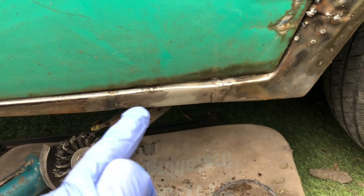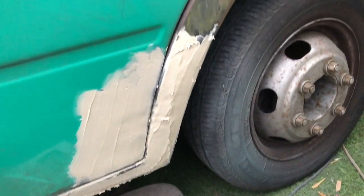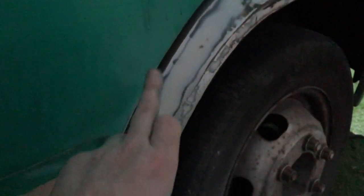There's the repair from there — blended it into what was there as best I could. That'll get a little skim of filler up there and obviously into the door. I've just put on the first coat of filler and knocked out the bottom of the door, as you can see — the door sits flush now. I'm just cutting this into the video: I went to put the phone on charge and carried on doing more. So far I've put a skim of filler down the arch, rubbed it back, got most of the shape there and put the second skim on. Got the door in — pretty close. All underneath has been done as well, with a plate put in there too — so that's ready.